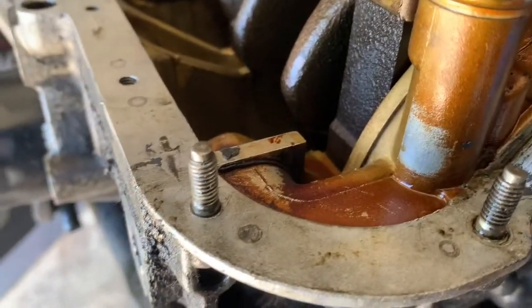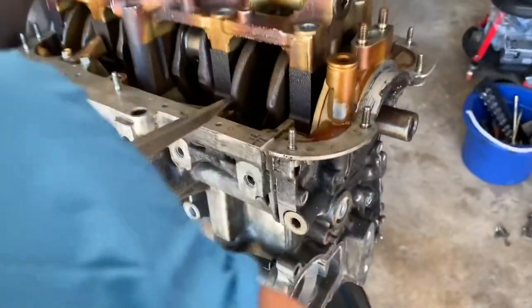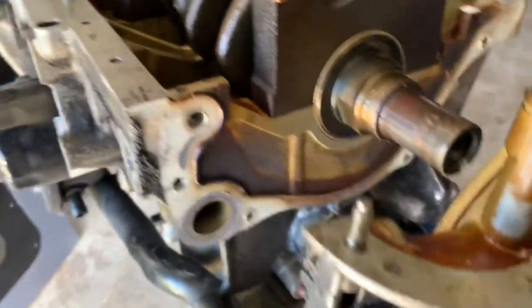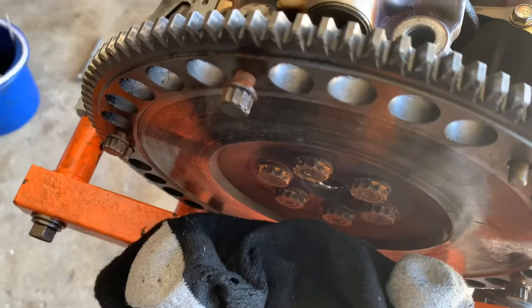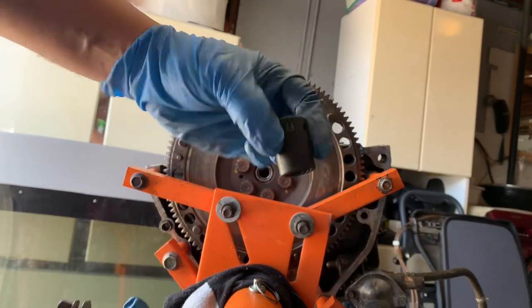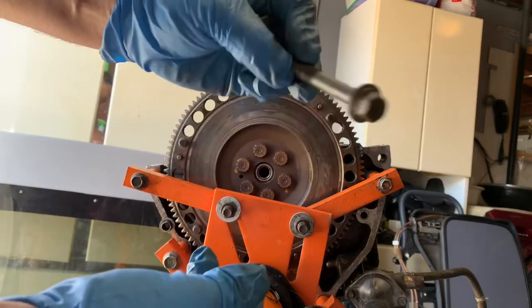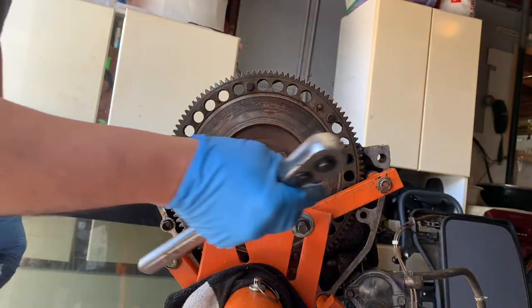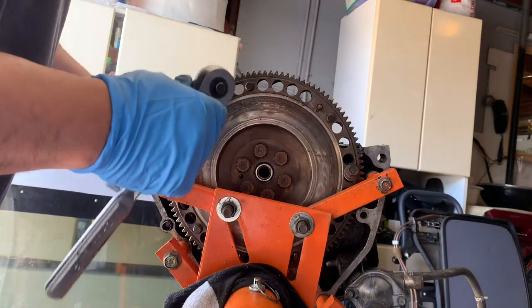Pull them and let's see if we can break it loose. The next one I'm going to take this one out. Okay, so we need a 12-point half-inch for the flywheel. Like in the other video, I've just put a bolt in between where the holes are to prevent it from spinning, and then let's take them out.